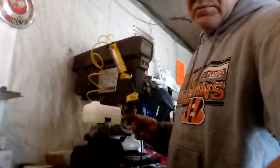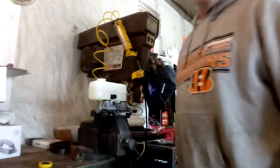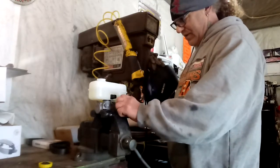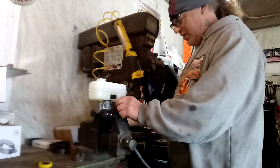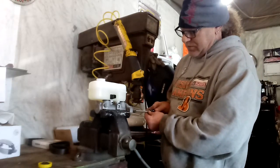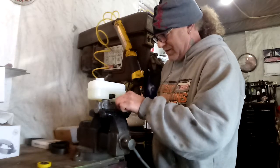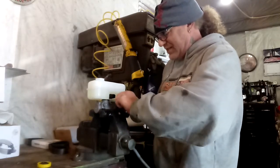We're back where I left off, bleeding this up and finishing bleeding this master cylinder. I'm going to get my screwdriver. We're going to push this in one more time, unscrew this one, do these one at a time — push it slow. That way you don't shoot brake fluid everywhere. Push in the center. It's still got a little air in it.